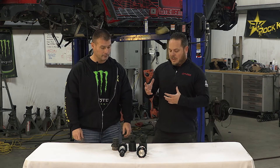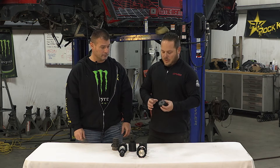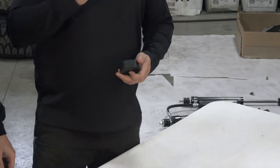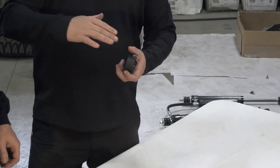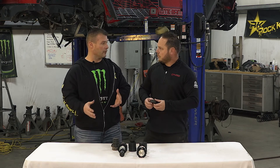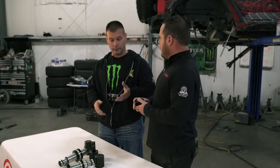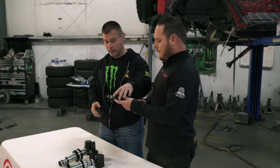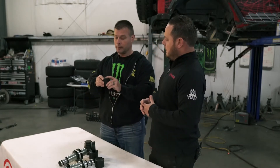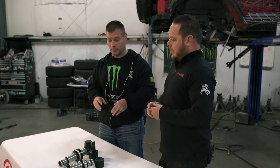We're going to go over the first basic type — the puck style. The factory has a rubber isolator on one end and generally a pad on the other side to strike against. It's generally a closed cell polyfoam bump stop on top, something that's quiet when it makes contact with the mating surface. All you're doing with these bump stop pads is stacking them on top of each other and bolting them in place to stop your up travel — either to prevent your shocks from going solid or to avoid other interference and clearance issues.